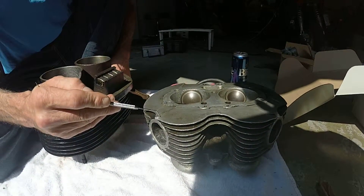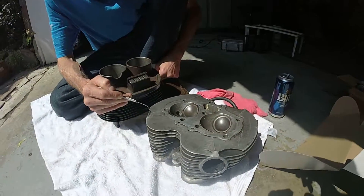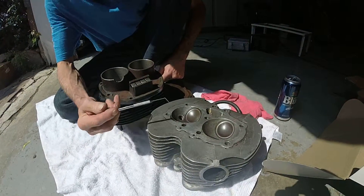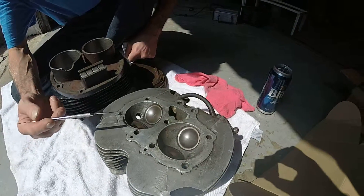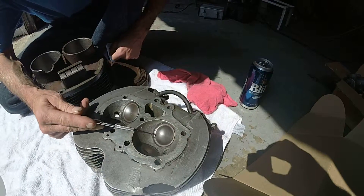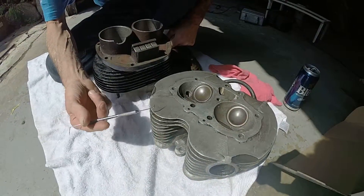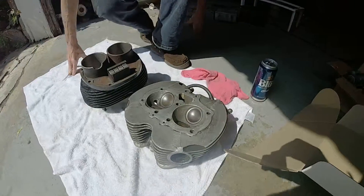Then I found the head here — it's got cracks in it and chunks missing out of it. I believe there are six places where there are pieces missing. I haven't tested the valves to see if they leak yet, and they don't look like they're bedding into the head badly. Everything else looks like it's in pretty good shape. I told him let's see if we can get our hands on a replacement head, and he has some nice pistons.